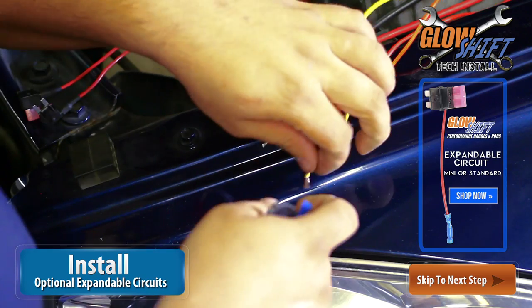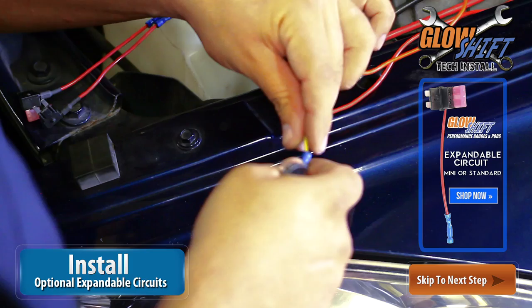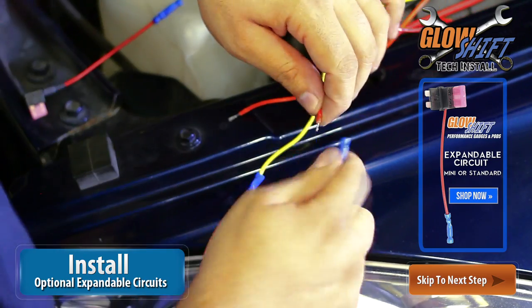Using expandable circuits will make powering your gauges much easier and eliminates the lengthy process of having to cut and splice wires. Connect the orange, yellow, and red wire each to an expandable circuit.